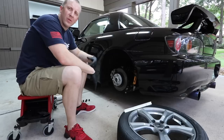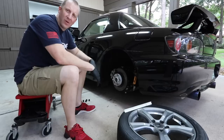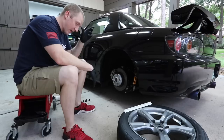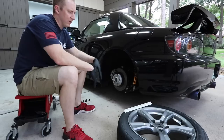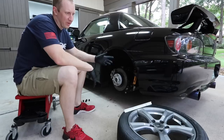I've got this scheduled for next Friday. I'm going down to Dynasty Auto — the place where I did my M3 alignment — and we're going to put the sway bar on, put the rigid collars on, and then adjust the alignment. I'd like to dial in about 2.7 degrees of camber in the rear and probably 2.5 in the front. Right now I have near-positive camber and that's affecting the steering quite a bit. We'll also put the Origin Fab A-arm control arm offset spacers on. Hopefully if I'm lucky I'll be able to just put the wheels on and be done when the Volks come in.